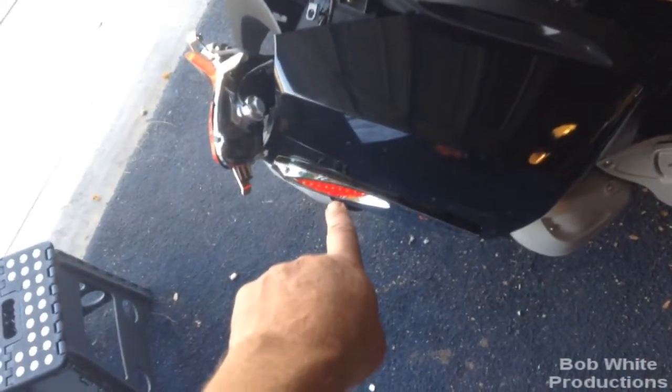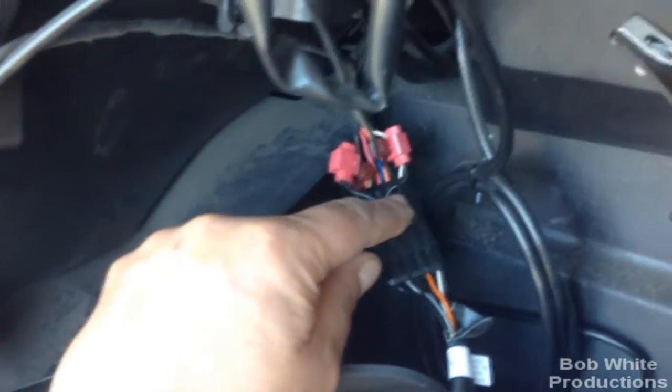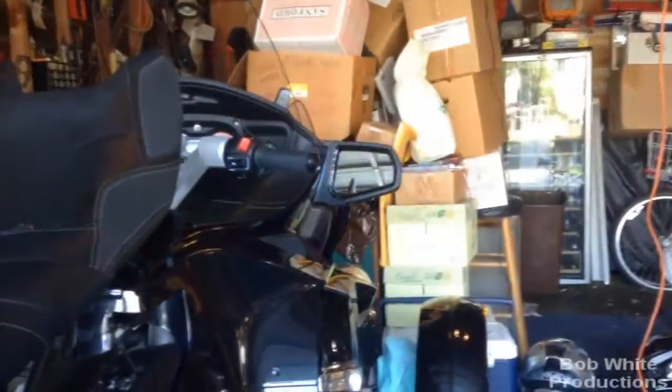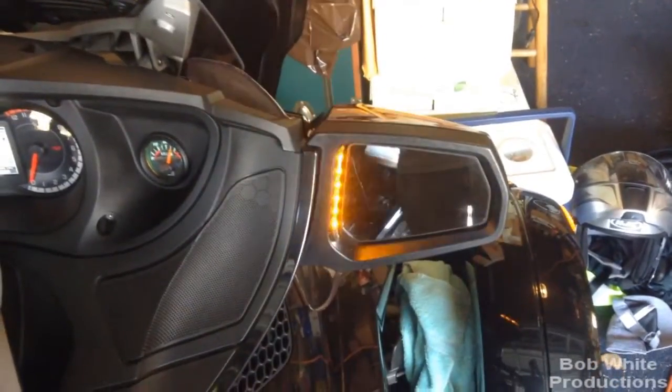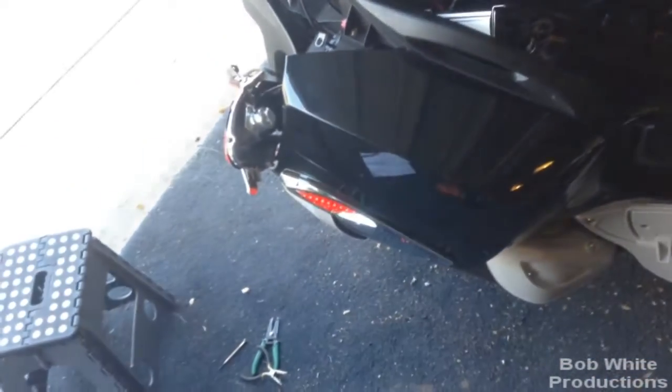I'm not so sure about the setup. One thing: at least in California, turn signals aren't supposed to be red. So I'm not sure this is even okay as a blinker. What I'm probably going to do is double up — they had me tap the blue into the brown and white, and the orange with the blue and the red. I've got to figure out which one is turn and which is running, and just make this an exceptionally bright running light. The flasher unit or something may get a little warm and then calm down, but if you leave it off long enough it'll fast blink again.